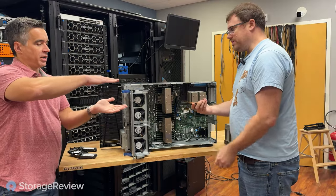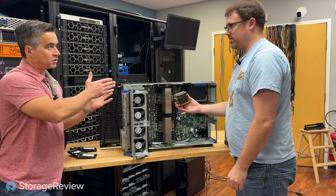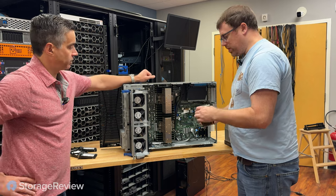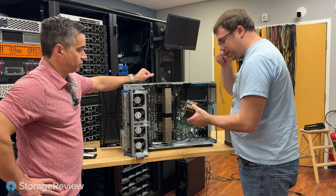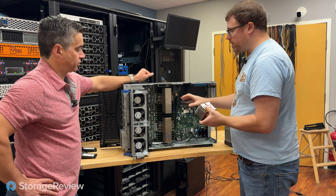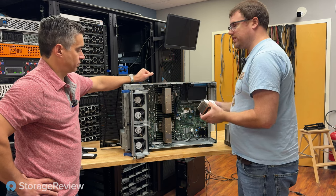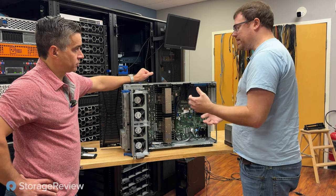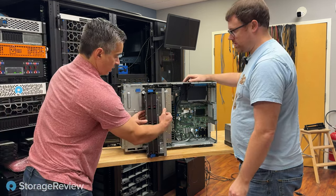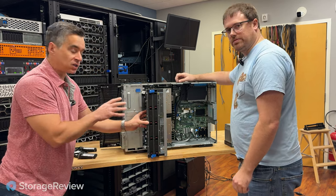You've got to remember that a typical server heat sink is in a 2U server. This is effectively a 4U server, so they've got to use the fan and air movement properly for a tower. You can move a larger volume of air at a slower speed across these heat sinks, which works well if this thing sits in a small office — same airflow, but less noise. This has got a fan bank with eight hot-swappable fans. The default single-proc system will only ship with three, so if you configure it lightly with one CPU and a couple of fans, it'll be pretty quiet.